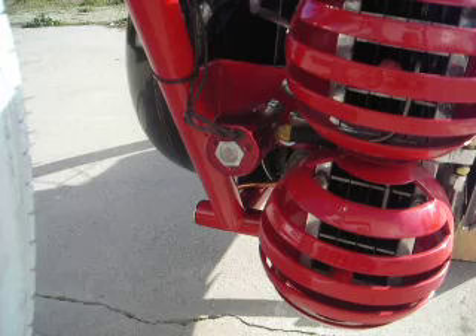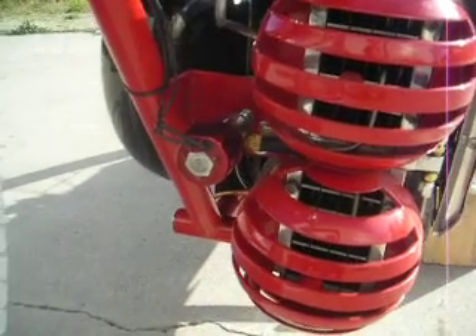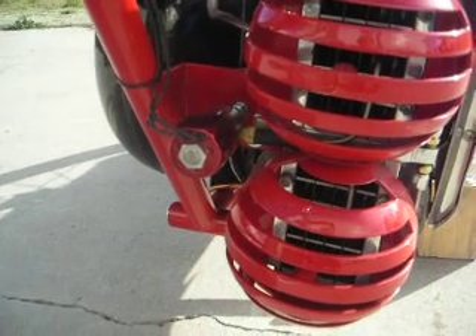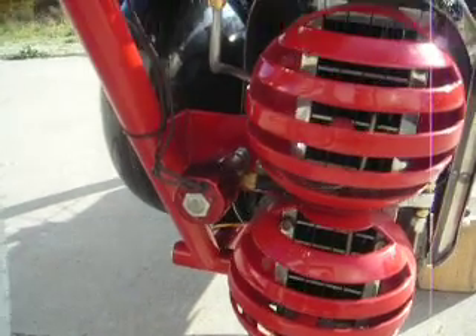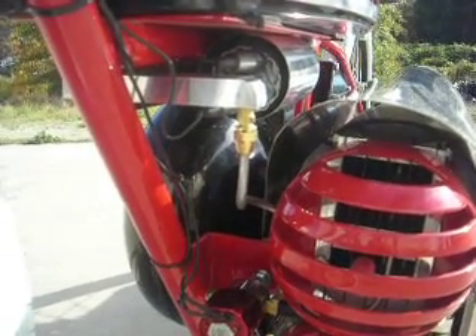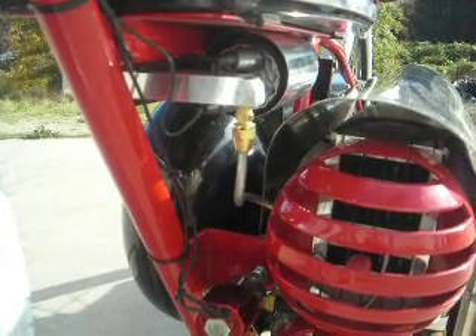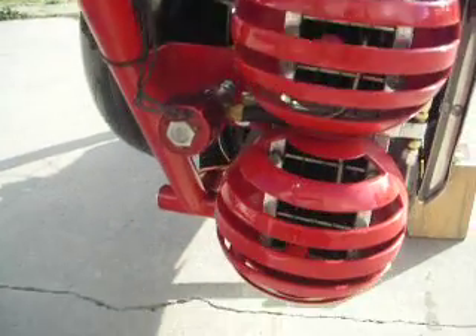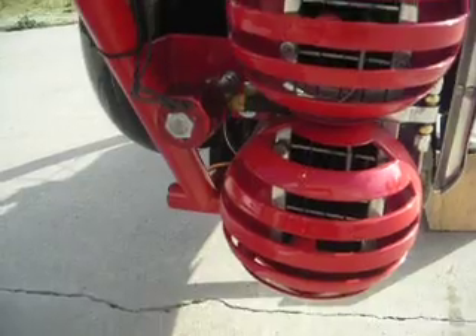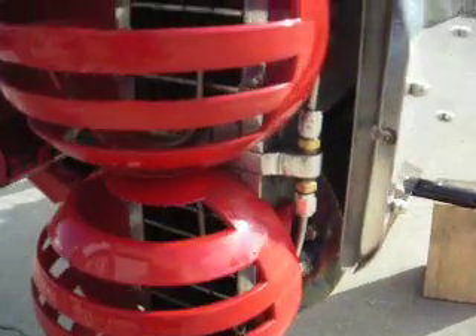Right there it's got an electric solenoid coming straight out of the frame to take the air out of the frame into the engine. You push a button and it opens the solenoid and shoots air into the engine. Fuel comes down from the fuel bar up on top — both fuel pumps are just plumbed into the single bar. Turn one on and it gives you half pressure; turn the second one on and it gives you full pressure, so that's how you throttle it. Fuel comes down to a bar in the center, goes through the other side, and goes up into injectors inside the engine.